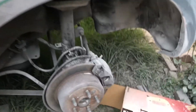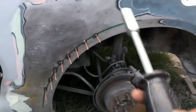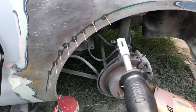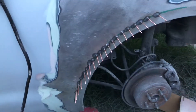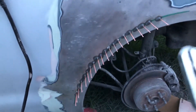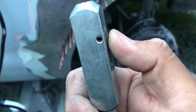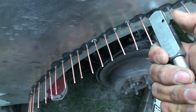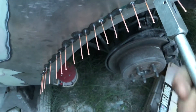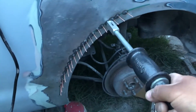Set that down and then the kit comes with a slide hammer — it lets you know it's from China. We're going to go ahead and put the stud puller on that. I went ahead and welded a couple more just so I can match the line of the curve. The way you put this on — there's this little thing here, you can see how it goes up and down. When it goes down it locks on the stud.